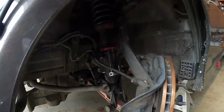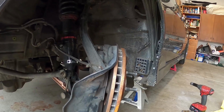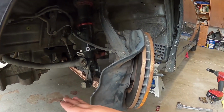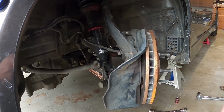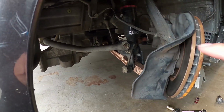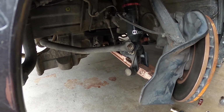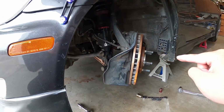It doesn't have too much camber, so if you're into that camber stuff, it definitely isn't enough. The control arms have camber adjustment, and right now it's set to max positive, but in combination with the extended lower control arms, I'm running about -4. When you lower the camber in the front with the stock arms, you actually gain caster, and caster is more important for drifting because the wheel will self-steer more. If you're drifting, you need to turn right, transition, you let go of the wheel, and it will just spin faster with the higher caster, which was my intention. I actually have almost 8 degrees of caster with stock arms, with no adjustable caster arms. So the move is to extend it and push the camber to positive as much as you can with the stock arms, but this will give you negative. So a -4 setup right now.